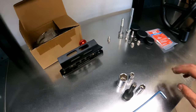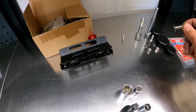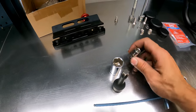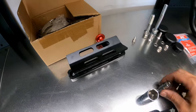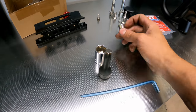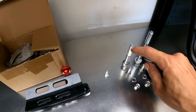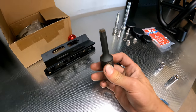The tools you'll need are: a 5mm Allen wrench for the countersunk bolts on the fire extinguisher mount, a 13mm socket also for the fire extinguisher mount, a 10mm socket for the top bolts — which also removes the stock bolt already in that location — and a 19mm socket for the new mounting hardware replacing the bed bolts. For the bed bolts you'll need a T-55 Allen socket.